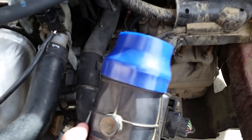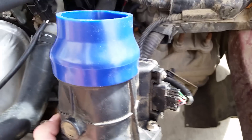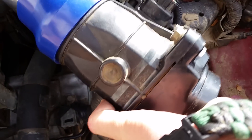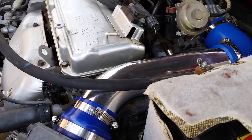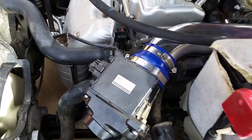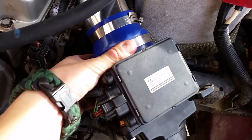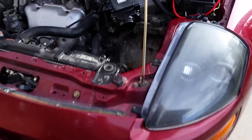Once you sit there getting your silicone piece onto your MAF sensor, you can tighten it down with a hose clamp right there and then reconnect it back up here and you'll be fine. By the way, your throttle cable here — you're going to want to make sure to put that on top of the hosing and not below it. I've got the MAF sensor all hooked up, so now just got to get the final piece.